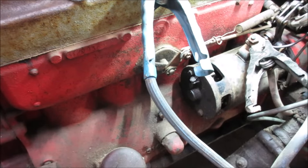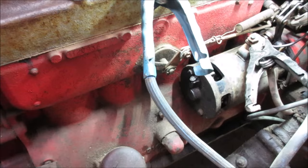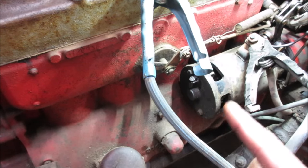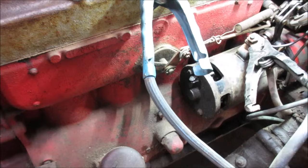I'm also, you know what? Let's go take the battery that's in it out of it, because it's still hooked up, I think. Let's go look. That might be causing a draw too. You know, it's a dead battery. If I'm trying to backfeed the dead battery, it's still hooked up. Why don't you tell me?